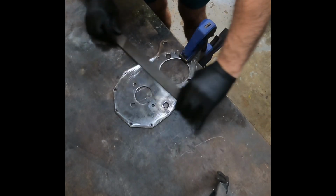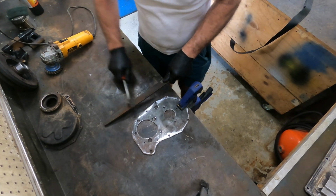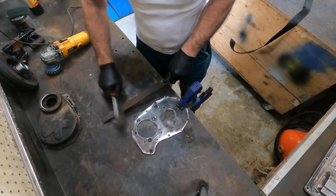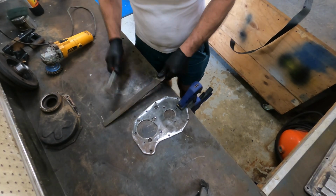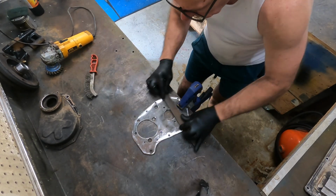We also need to make sure that as you're going, give the file a good clean. With the wire brush, you give the file a brush off. That'll get rid of any debris that's collected and will reduce any bad scoring. Turn it over and have a go on the other side.